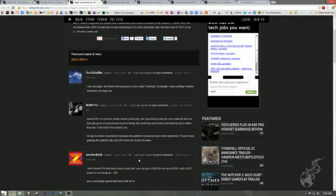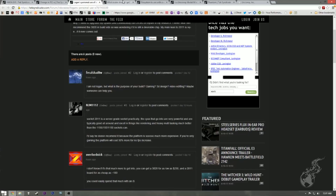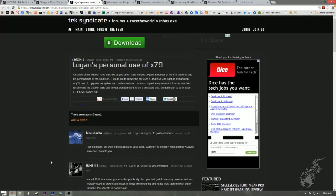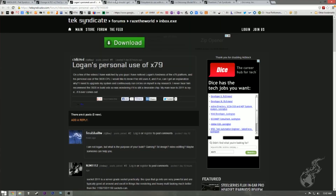What's the purpose of your build? Gaming, 3D design, video editing? That's exactly what you need to be asking yourself. If you're only doing gaming, you do not need socket 2011, especially with one GPU. I'm also the kind of guy who doesn't upgrade my machine for a while because moving software around is a pain. You don't need a 3930K unless you really need a workhorse machine that's going to last five years. It'd be better to get Haswell or something cheaper more often — get two of those. Or if you're just gaming, get an 8350 with the biggest graphics card you can find, because newer games are being optimized for more cores. Getting a new machine every 18 months with that strategy is much better than buying a really nice X79. In two years you'll be faster than people upgrading in five-year increments.